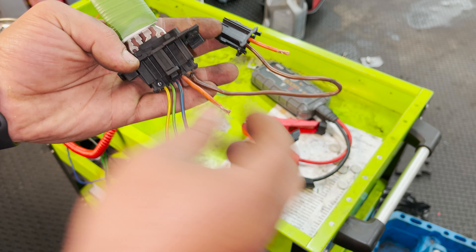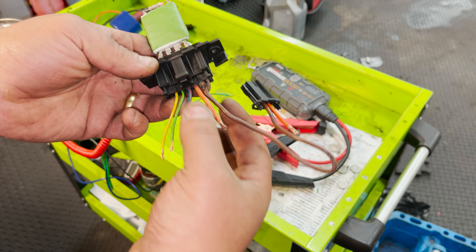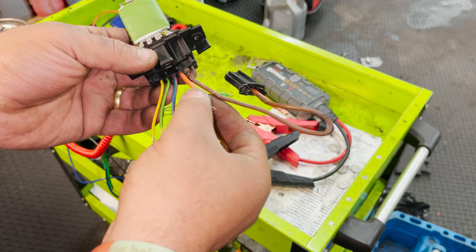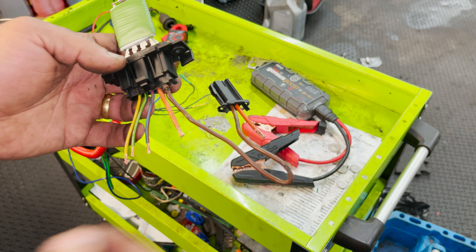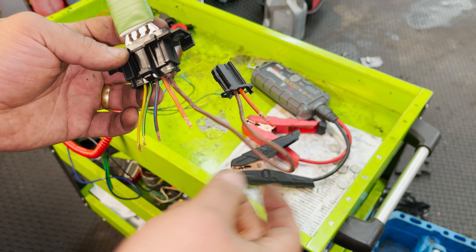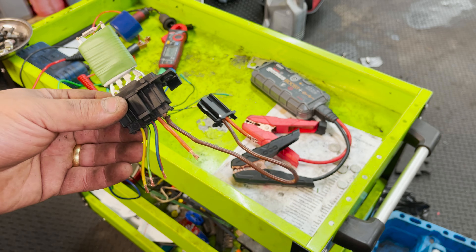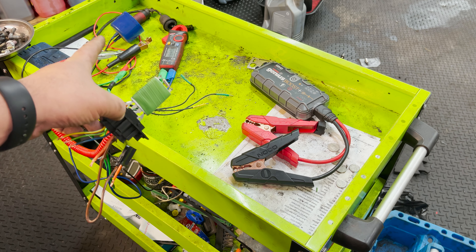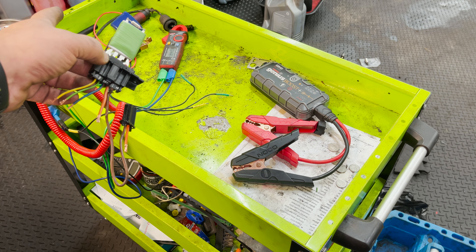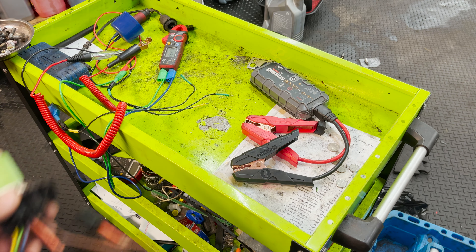Position four goes through here and that terminal on the resistor is slightly thicker because those two wires are shorted there. What Vauxhall did on the new harness instead of having those two wires shorted there - they eliminated the brown wire. You have position four and the main ground just joined together going straight to the motor. That's why we only have four connections - it eliminates the brown wire joint. The test light needs about 100 milliamps while the light bulb needs about three and a half amps for full power.